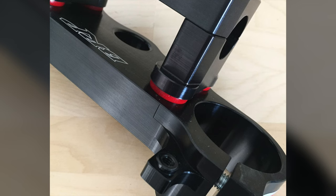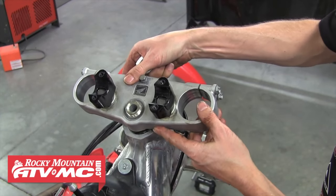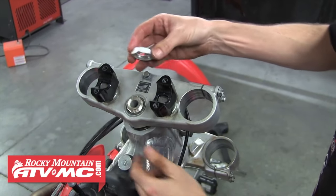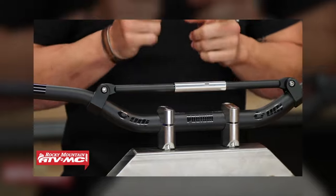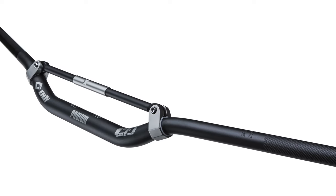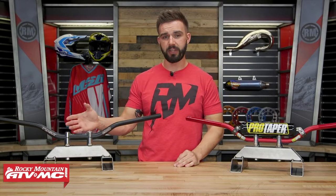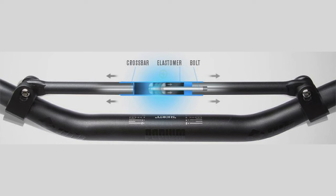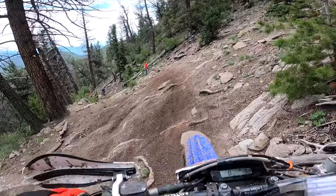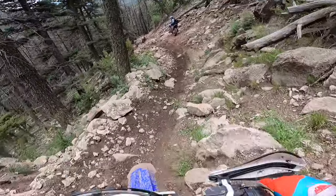BRP's offering will run you around $300, which starts to get up there in price. I also wonder how the aftermarket triple clamp performs against stock triple clamps — the clamps that come stock do so for a reason, as they generally perform best in the ways the OEM wants the bike to handle and perform. Before we talk about the Flex handlebars and the Mako 360, we need to mention ODI's Controlled Flex Handlebars and ProTaper's Fusion Handlebars. Both bars do the same thing in slightly different ways — sitting somewhere between a crossbar and a crossbarless oversized handlebar in terms of flex characteristics. The ODI Controlled Flex has an elastomer inside for tunability, where the ProTaper Fusion has an on-off crossbar feel, making it an option if you go between crossbar and without.